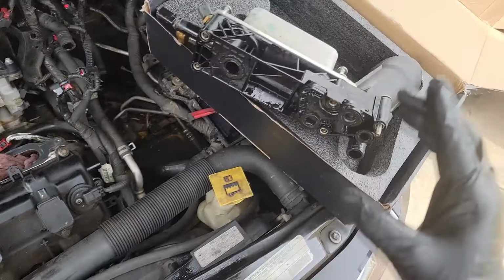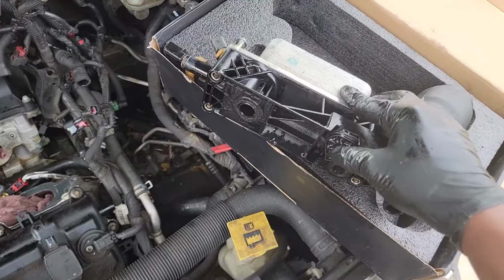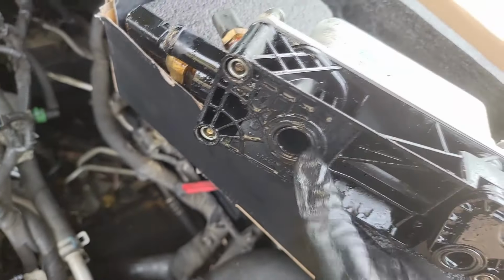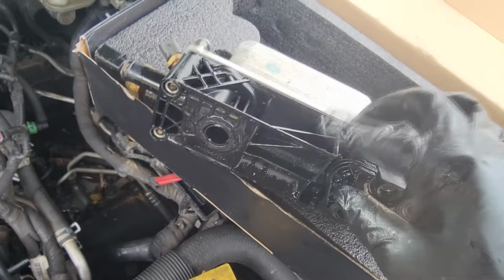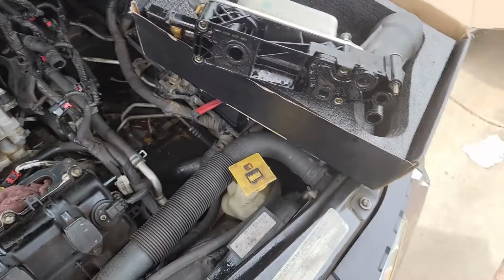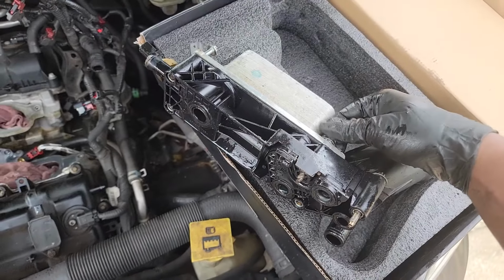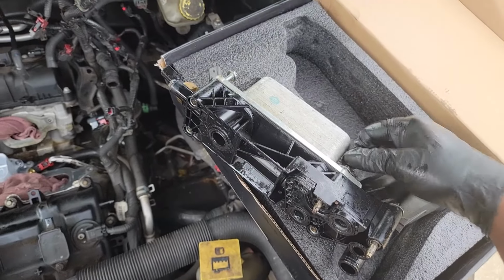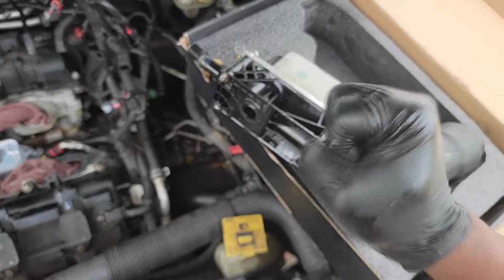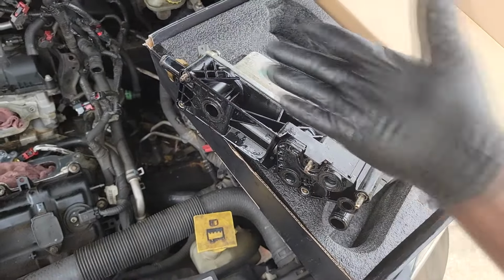Okay. So the secret or what you can get out of this is, look, this is so flat that it had no choice but to ride on the block. Now one could argue, well, if you torqued it down, you would have been fine. No, because at that point, all you're doing is compressing this plastic tighter up against the block. It just has to be replaced.